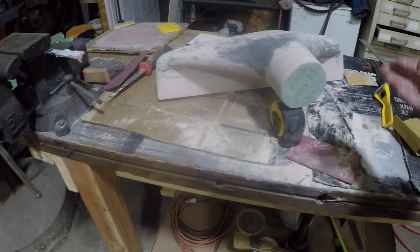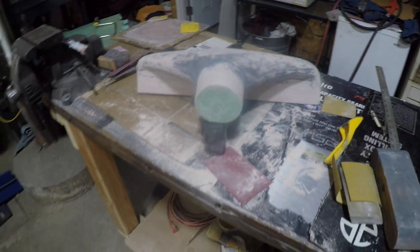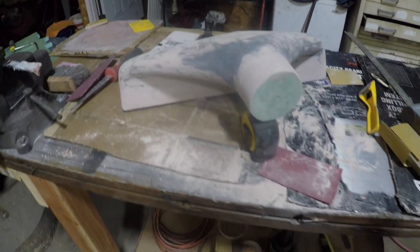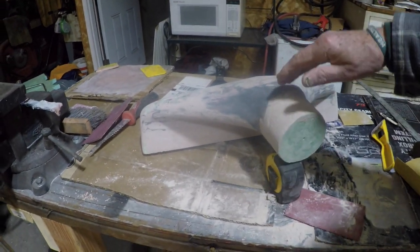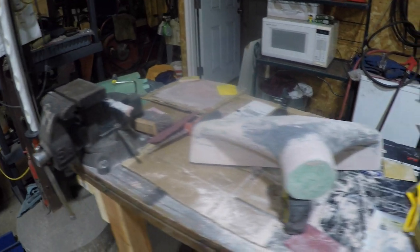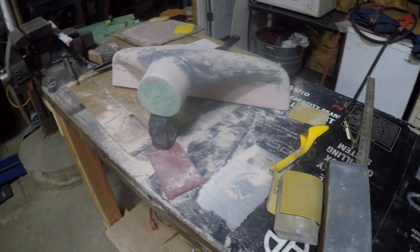On the A3, ports one and two are buried, and somewhat six as well — not as bad as one and two, but six is buried also. I have some extra foam material left over, and I'm thinking about making two of these things. As long as I'm doing it, maybe I should get some more material and make another one where the pitch on this runner is more conducive to forcing air into those pockets created by the plenum on the head.